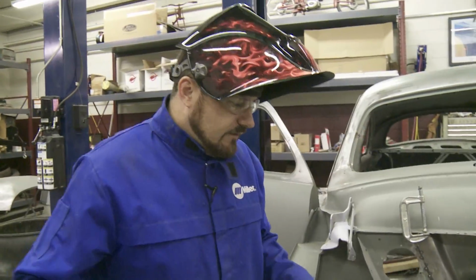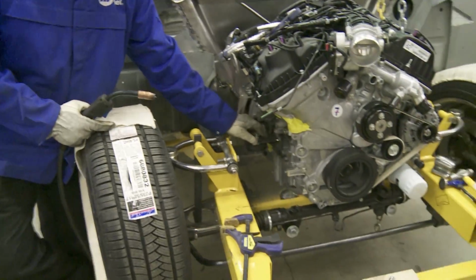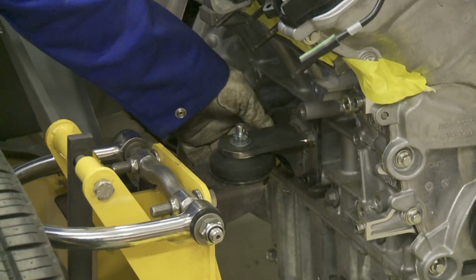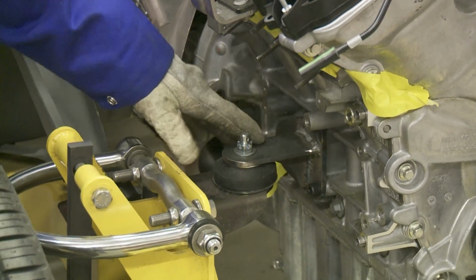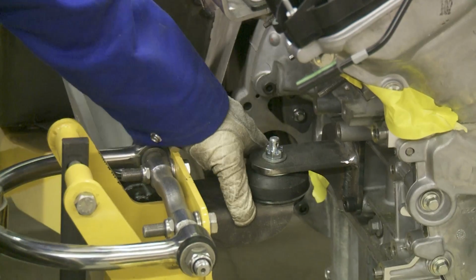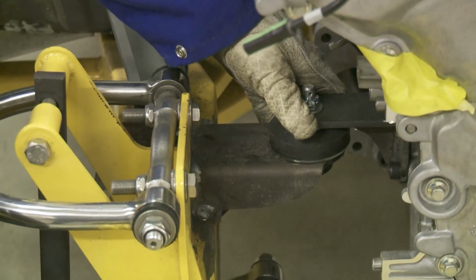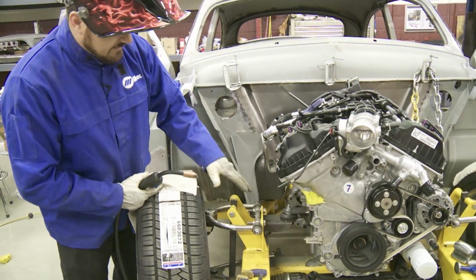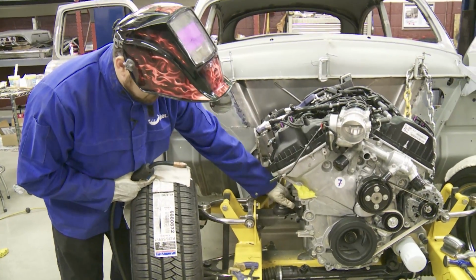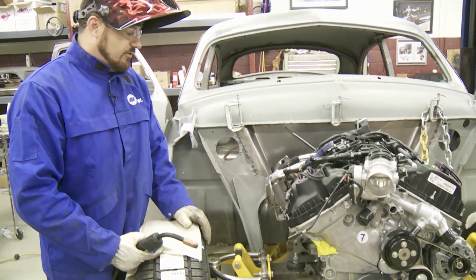All right, so as you can see, there's our motor mount that we'd made over there on the welding table. We had our pattern turned out perfect. It bolted right up to the engine mount on the motor. And for our motor mounts that came to the chassis, we lucked out, got some late 40s model Ford motor mounts from the Honest Charley Speed Shop right off the shelf. And we've adapted it to the chassis and the motor to where we've got a good strong mounting point for the motor.